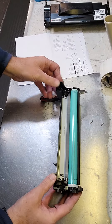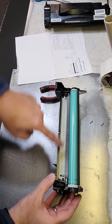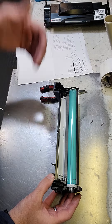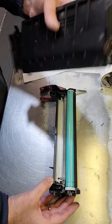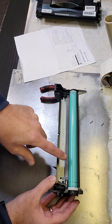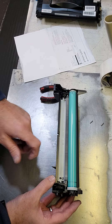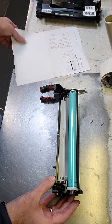The reason why it was doing those repeating prints is because of this. If you can see the white toner — this is called toner additives. This charge roller is a third-party compatible charge roller. It's not even only a compatible toner cartridge made from new parts instead of the recycled parts you could get from a genuine HP toner cartridge. These are the worst charge rollers ever. I've seen this so many times with other compatible toner cartridges collecting this toner additive and actually causing this type of problem on the page.